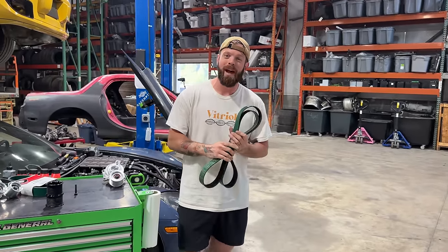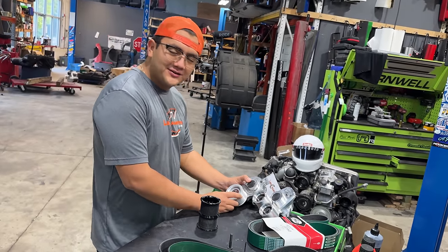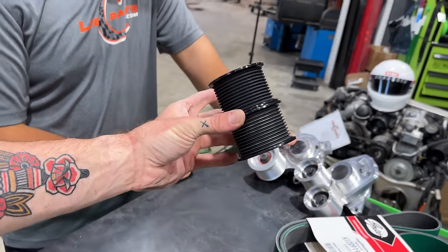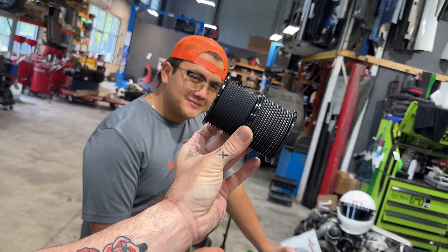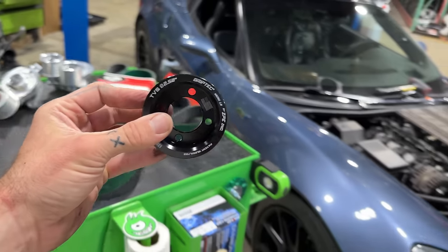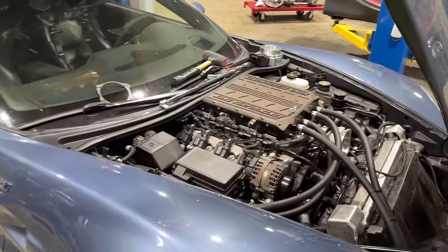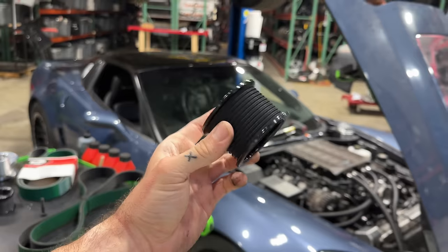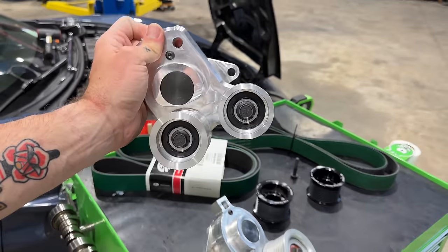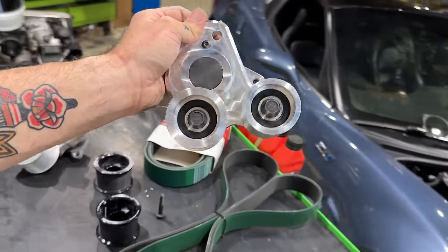So just changing the pulley is going to increase 50 horsepower? No — it's more so this right here. This is what we're counting on doing it. We do have a massive advantage using that 2650 blower, because if we were using, say, a ported stock blower like on my last car, you have to go down to a 2.3 or 2.2 pulley, which is tiny. Belt slip on that is much more prevalent. But this is a new tensioner setup from Kong Performance that adds an extra idler and changes belt wrap.